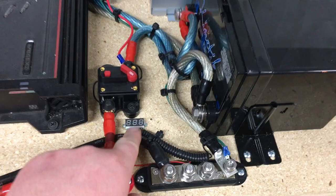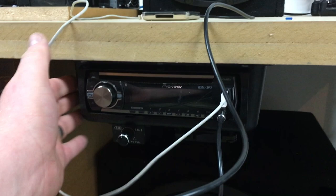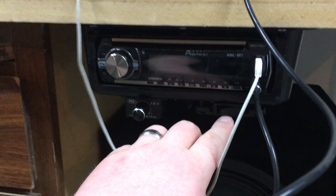That's basically the wiring. I do have a little voltmeter here so I can watch my voltage. Now there are a few other things to actually provide a signal source. Coming down here, I put this single DIN head unit in a universal under-dash mount box. I have a bass knob and a switch — this switch acts like the ignition, powers everything on, and that's where the RCAs are coming from into the amplifier itself.